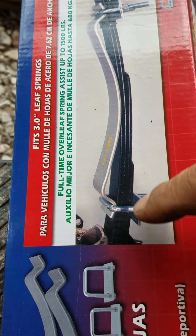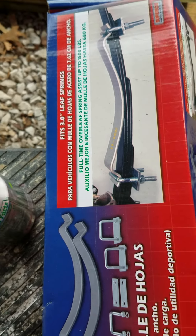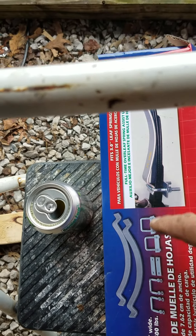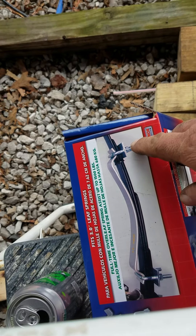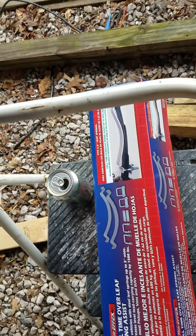Then you can just draw it with the bolts and it'll draw up as you go. I didn't have a 13/16" — I had a deep well socket. On the back side you're okay with the deep well socket because the leaf spring is thicker, but on the front I had to add some washers in order to use my deep well socket because it was bottoming out.